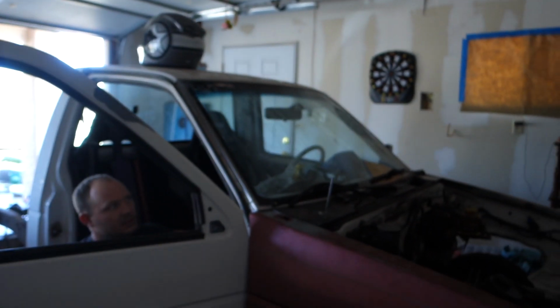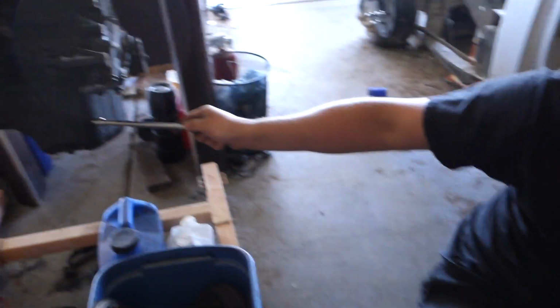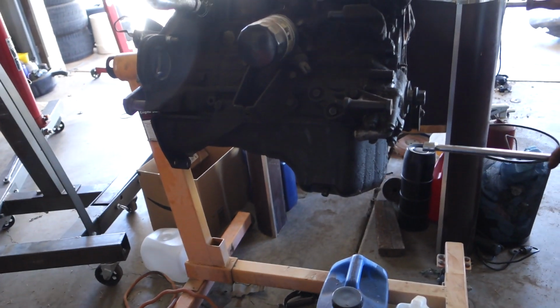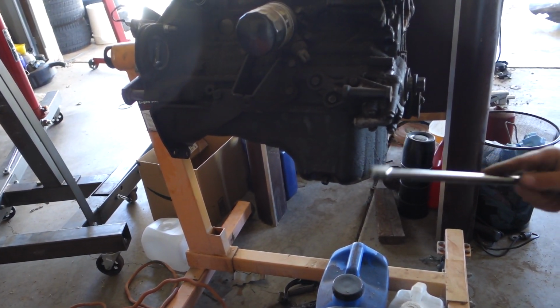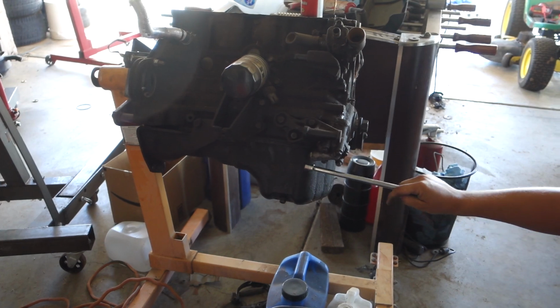Because we're doing that, we'll kind of have a how-to on how to fit a 240SX single overhead cam motor in your hard body, because the oil pans are different. What else is different? The cam check? Yeah, but as far as fitting it in the truck, the biggest issue is the main girdle. On the truck, it has main caps, like you saw on the teardown video. Individual caps. This has them all attached, they're all one piece. Right.